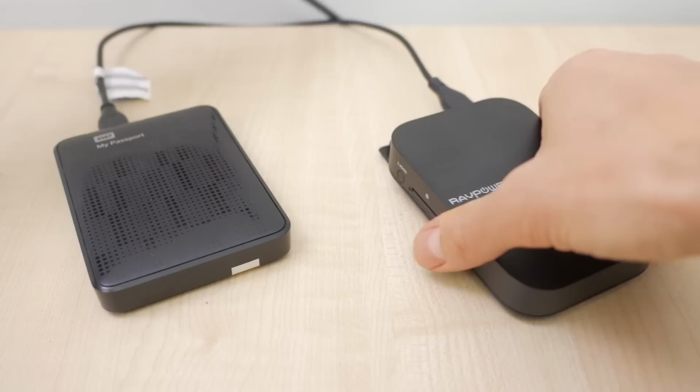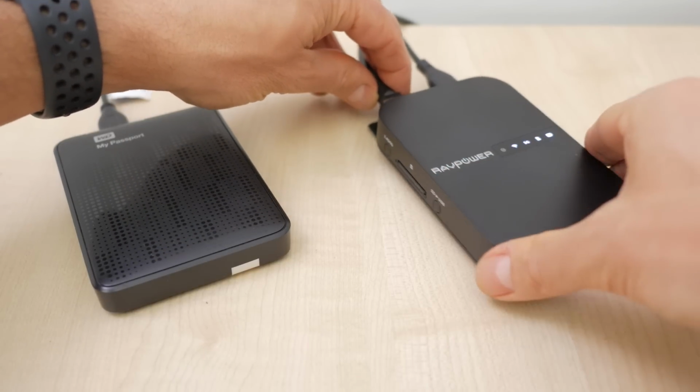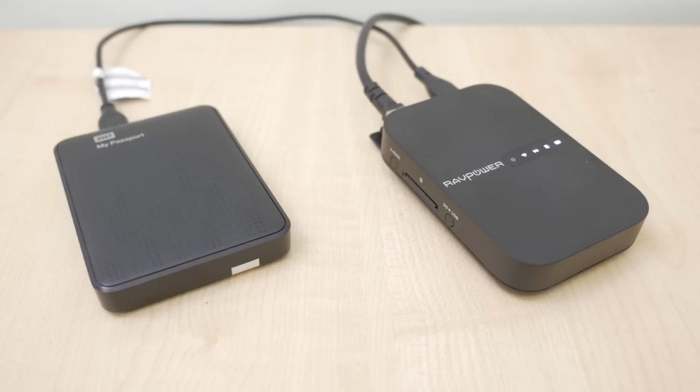One handy feature is as a portable wireless access point. For example, in a hotel room where perhaps you only have an Ethernet connection, you can just plug the Ethernet cable into the FileHub. There shouldn't be any further setup as long as you're connecting to a fairly standard network. The internet LED on the FileHub should light up. You can then get wireless internet access via the FileHub, and others can connect wirelessly too. And you can still access files off the attached storage using the app as before.